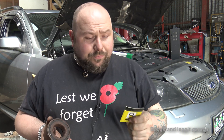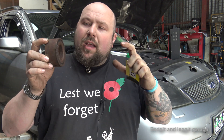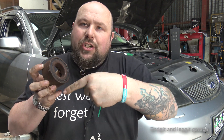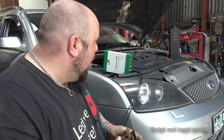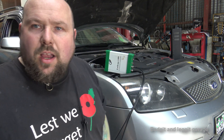You can actually see before you fit it whether the segments are okay. You can get these cards free or you can buy them. I've got a bigger one somewhere which is easier - you can put it over the whole magnet in one go - but I had to use the free one. You get the idea. Let's get to the setup of the scope - we're going to use two channels, one for voltage and one for our signal, so we can see both at the same time.